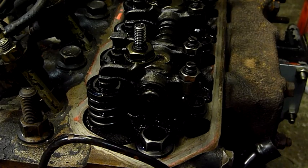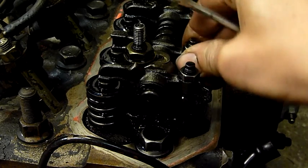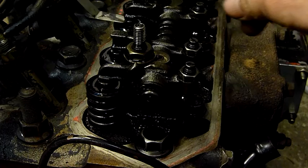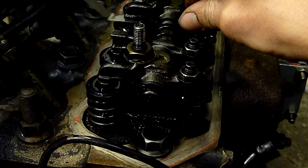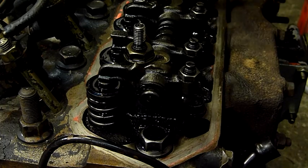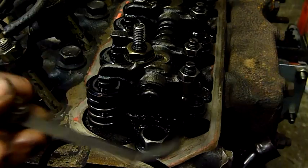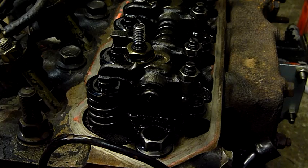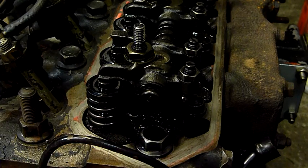Repeat the process for each one of them, making sure that they are not being operated by the cam. That one's now free. That one might still be under operation — that one's fully compressing so you can't touch that one yet. So you make sure they're all even and all within spec. Then you reverse the process of removing the rocker cover, making sure you've got a good gasket.